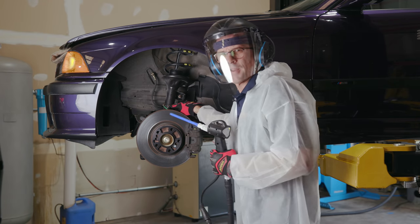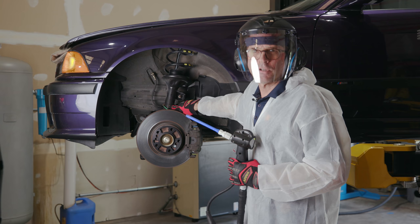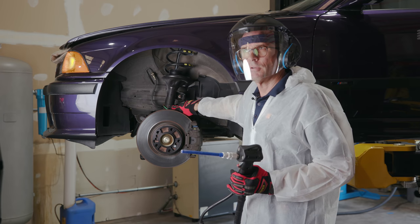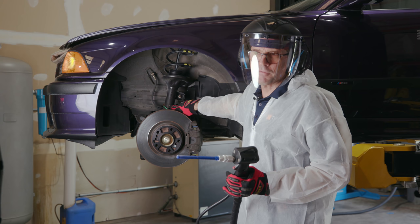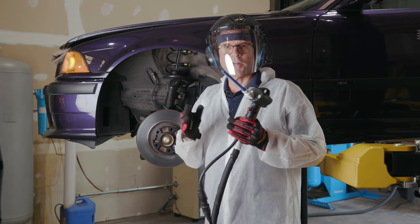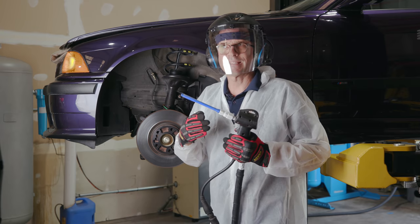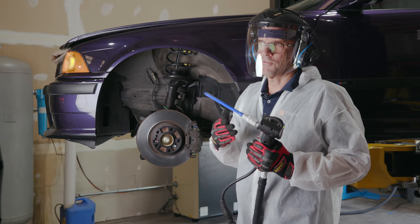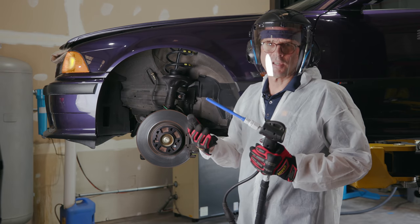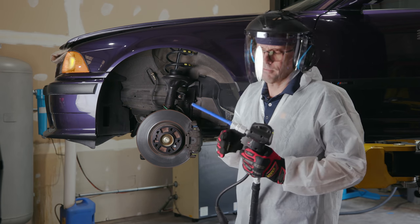And so here's the risk side of larger particle. If there's any paint that doesn't have good adhesion, you're higher risk with larger particle. So you're always trying to manage the time and risk factor of where you are and what you're working on. And I can't stress enough how important it is to modulate your efforts. You don't always want to just go in and clean a spot. You come back to it, because as that dirt gets frozen, thaws, gets frozen, thaws, that back and forth helps the process. So don't just go crazy and stay on one spot until you're happy with it. It could be worse than better.